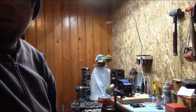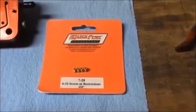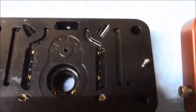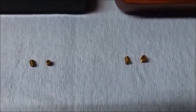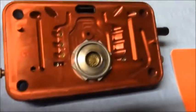Let's get situated over here. Quick side note: you can buy pre-sized bleeds. Some metering blocks will be able to use them, but not all. The reason is, right here where the emulsion bleeds screw in, this area of the Quick Fuel block is larger. On this BLP block it's much smaller. So for the BLP block you have to use the internal Allen hex on the left. And for the Quick Fuel block, you can use the internal Allen hex or the rounded head slot for a screwdriver. Personally, I like the internal Allen hex, as you can see on this metering block.